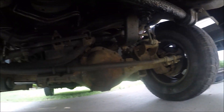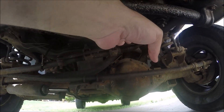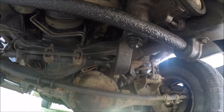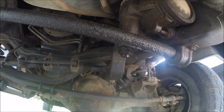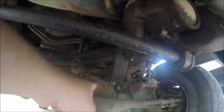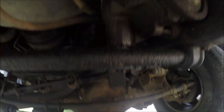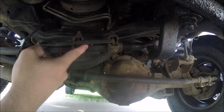It's got what's called a Y-steering setup, where you don't have a solid tie rod going all the way across. Instead, you have a tie rod on one side and a drag link that operates the steering. The steering box is leaking quite badly — actually it's the reservoir that leaks, which comes down the box and drips. I bent the reservoir when I replaced the steering pump a while back. Anyway, you steer via the pitman arm, which pushes or pulls each tire in the desired direction.